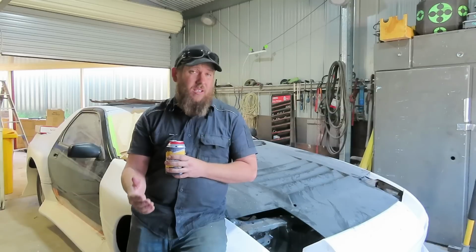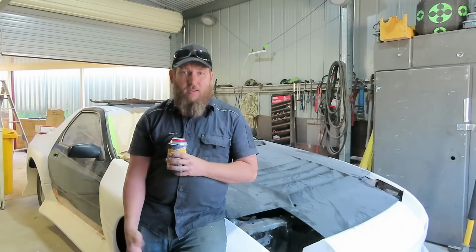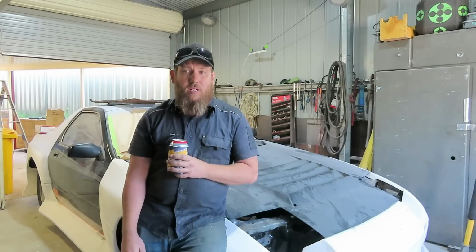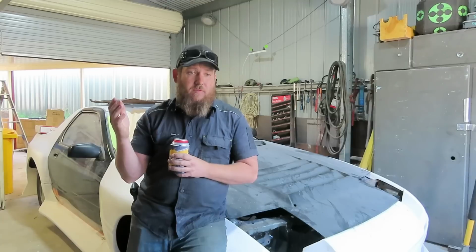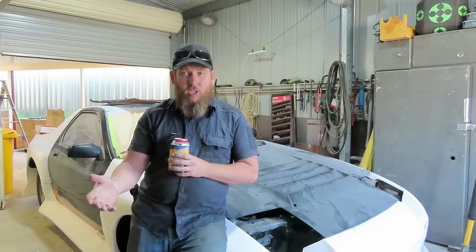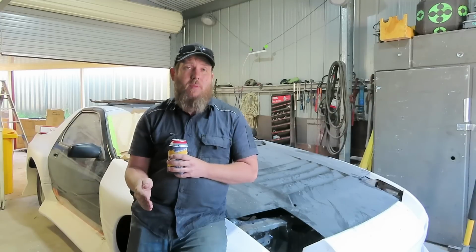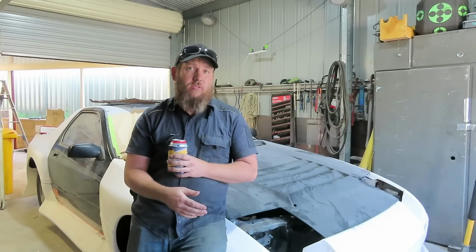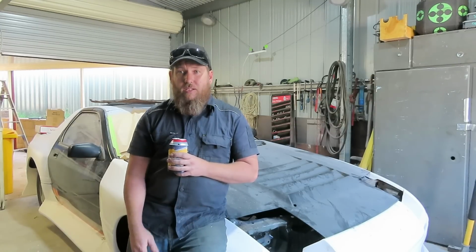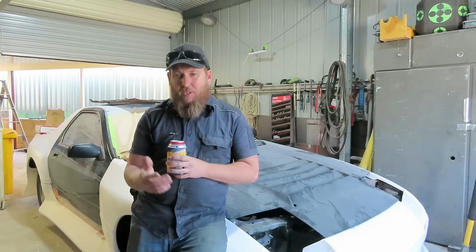A lot of stuff I didn't think of on that previous video, and some of them I've certainly taken on board. For instance, I have secured a 40 litre a minute electric water pump, heavy duty unit, and that will be my backup in case the impeller in the leg fails. Things like that I didn't put much thought into before, but now I certainly have.